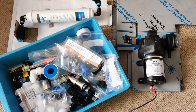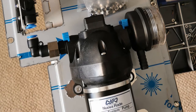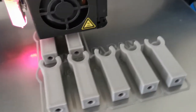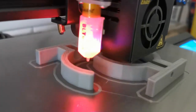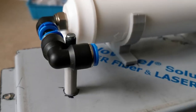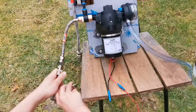This tank fits very neatly into the base of the trailer. We made an aluminum strap to help secure the tank once installed. We then worked on a prototype mount panel for the pump and filter, and later had this laser cut out of aluminium for a secure but lightweight mount. This will be the water system's control center, mounted in the right-hand side compartment. Some clips were needed to secure the filter to the panel — we drew up standoffs and 3D printed them ourselves. The PU quick connect system works really well, with securing clips to ensure pipes don't pop off unexpectedly. The 12-volt pump has a pre-filter, and we added an inline disruptor filter which the drinking water will go through.